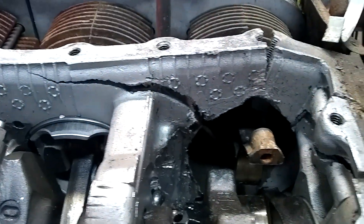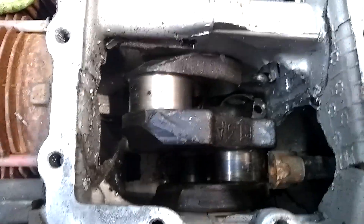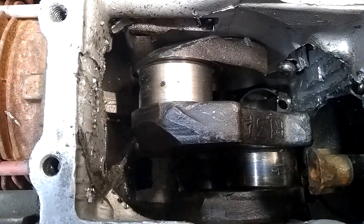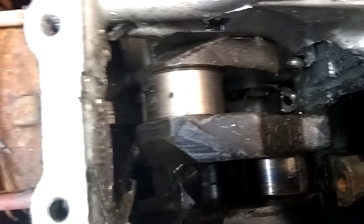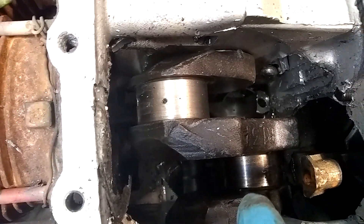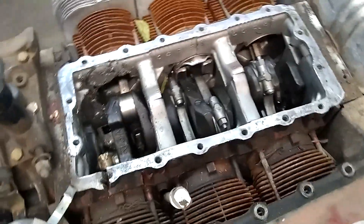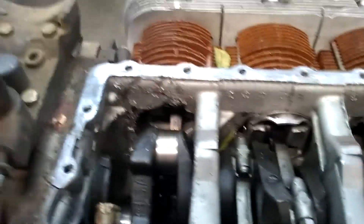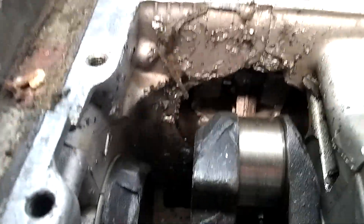You'll notice that the case is totally trashed. The crankshaft — I see some very dark signs on here. This means that it got super hot. Any time you see that, it was probably very high oil temperatures — it just quit lubricating. They start tossing things. You can see all the fragments that chucked out.